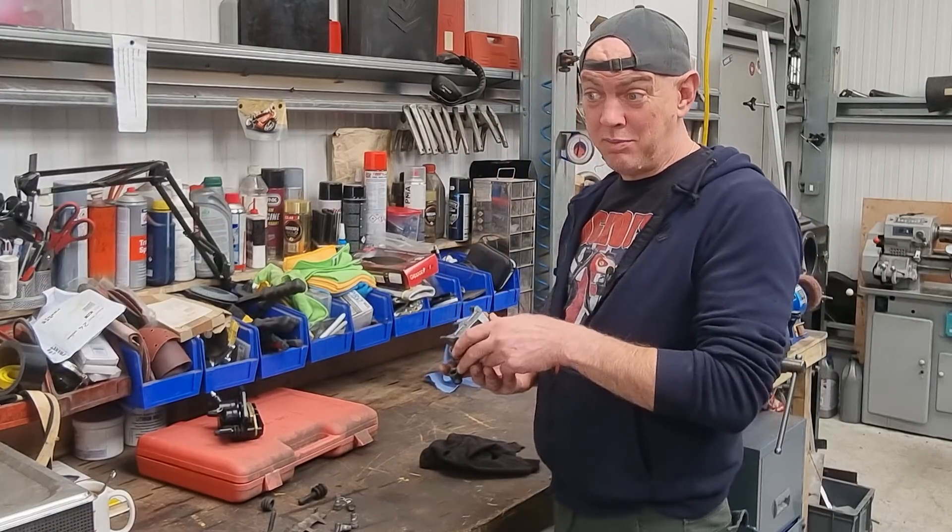We are cracking on though. I've been having a go at this rear brake caliper and he's just proving troublesome - he's never been on the bike. I can get the big piston out, can't get the little piston out - he's pretty much wedged. I've tried sticking a high-pressure grease gun on it and various other bits and pieces and it's not happening. So I'm just going to hook it back up to the rear brake hose, do everything up, put some fluid in it and see if we can't just pump it out hydraulically.